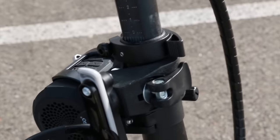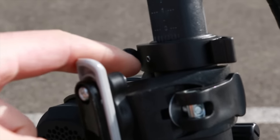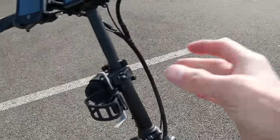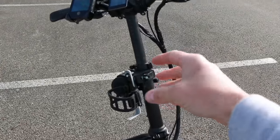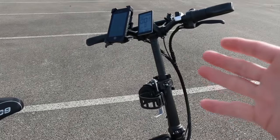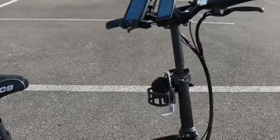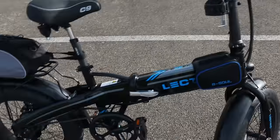When checking bolts, make sure you check the little bolt inside the hole that holds your quick-locking mechanism. Mine was actually a little loose, which made the clamp slightly loose. I also noticed a lot of creaking in the stem where it goes down. If I'm getting creaks, I'll unclamp it, move the bar slightly, and reclamp it — that usually clears it up. I initially thought the creaking was coming from lower down, but it's actually coming from inside where this section slides up and down.